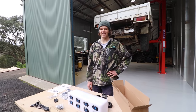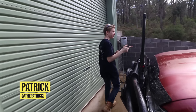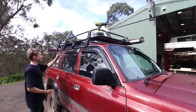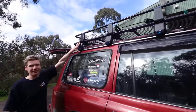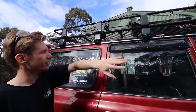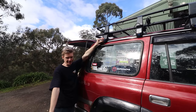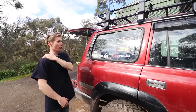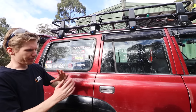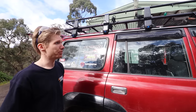As Liam said, I was going to do something a bit different and mount them on the roof, even though they're rock lights — to do a bit of a party light setup. What I've done is basically bolting them into the roof rack at the clamp plate for the gutter. I've done three so far and I've got another five to go. Once they're all on, they should hopefully point straight down and illuminate the ground next to me. I'm going to run the power and negative down into the door and get the wiring all streamlined and wired into my box.